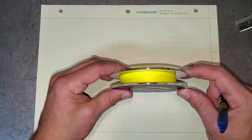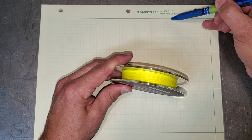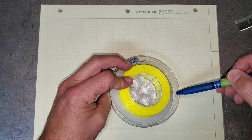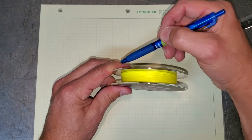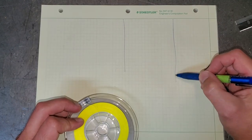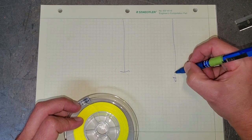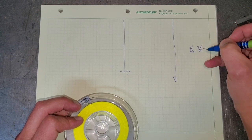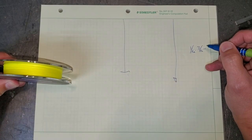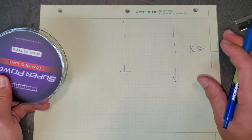For example, if this is the front left wheel and we want it toed in — I'm exaggerating — we're going to measure from the line perpendicular to the outer edge of the wheel at the height of the center of the hub. Then we measure from the back of the wheel perpendicular to the line. We'll have two measurements. One should be longer than the other for toe-in, and this difference is typically 1/16th to 3/16ths of an inch, depending on your car's spec. This applies to the rear wheel as well if you have adjustable toe.